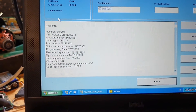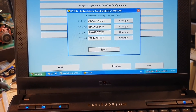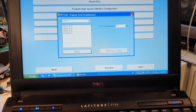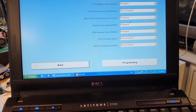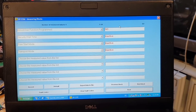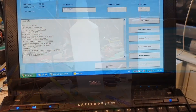I'm going to jump out of the ECU and go back in again. As you can see, everything is still there — VIN number, engine, everything. When I come to programming, my injector codes are still here, the VIN number is still there. You can change it if you want when programming to another car. All the parameters stay. However, when I come to display immobilizer status, it now tells me the immobilizer function is no longer programmed — so the ECU is ready to be programmed again.